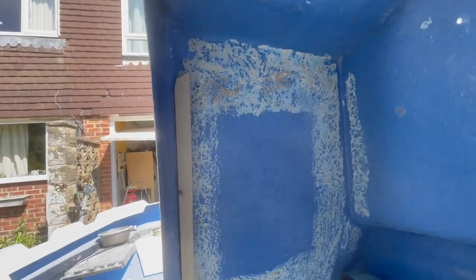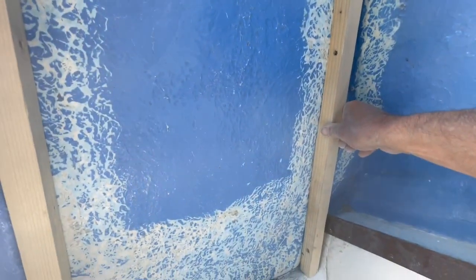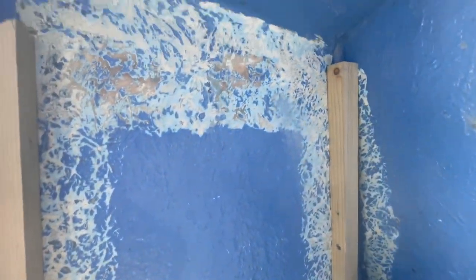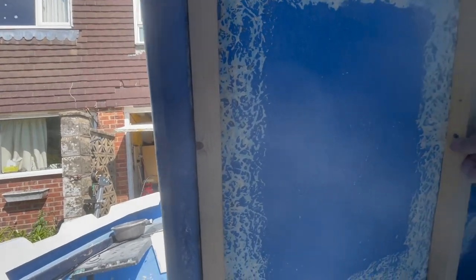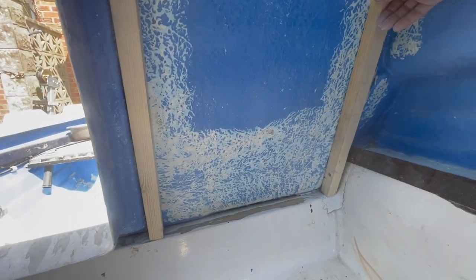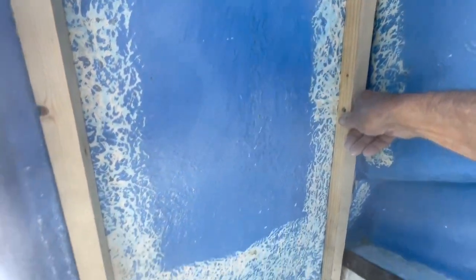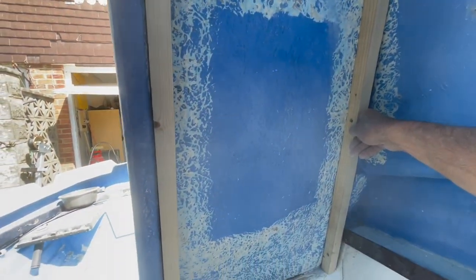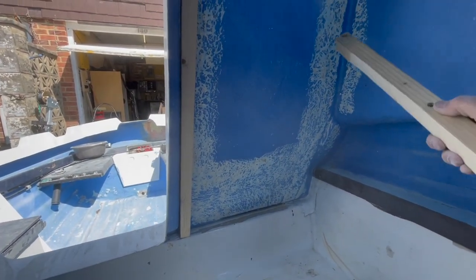Right, I've enlarged this area and I've got the old grinder and I've moulded a piece of wood so it fits perfect in that corner. So I'm gonna knock up some resin, stuff it all around, paint it on, and then I'm gonna pre-cut some strips. I'll make the resin not so strong as I want to be able to play with it for quite some time. So anyway, let's do that. Let's crack on. Let's get this boat in the water one day.